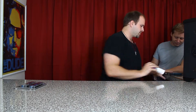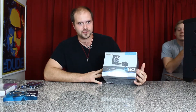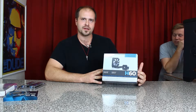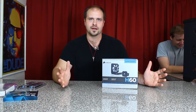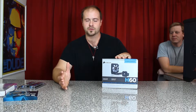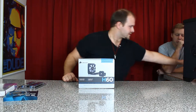We've got some cooling fans which I'm actually going to put into the case. And then what I have not unboxed yet — this is the Corsair H60 liquid cooler, and this is what's going to keep our Haswell 4770 processor cool. I was looking very specifically at the LGA configuration, and the Corsair website says this particular liquid cooler works with the LGA 1150 pin configuration, which is the processor we want. Let's get this thing open.